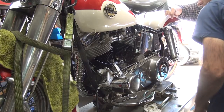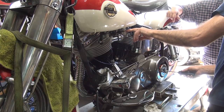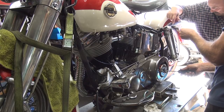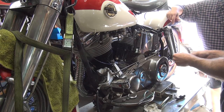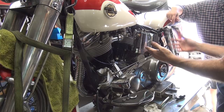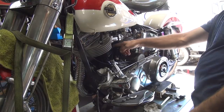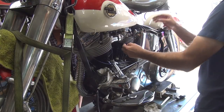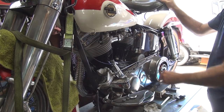I just put the gas tanks up on there for you, the fuel lines don't fit too well. You've got to go from a modern to old - there's an adapter on the carburetor on an even seat. They also make one that goes on the fuel strainer, but I haven't had a chance to go digging for that yet. Kali makes a fitting kit so you can put it in three different locations. So if you can put the stock fuel strainer over there and just have the hose come into it, it'll look a lot cleaner.